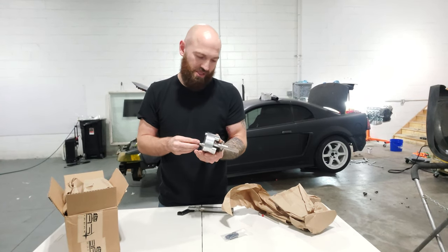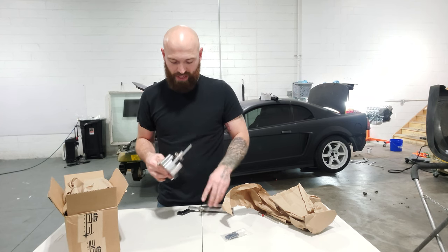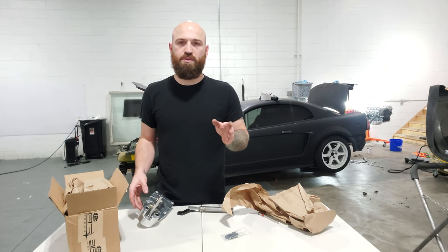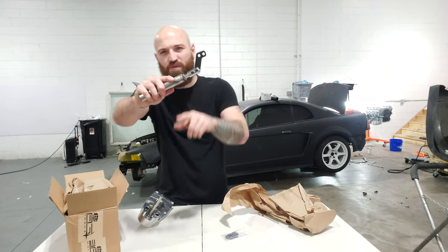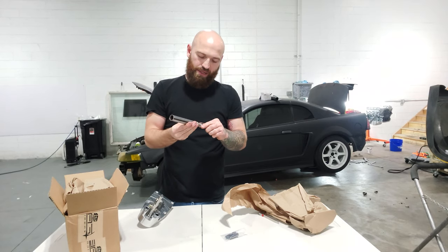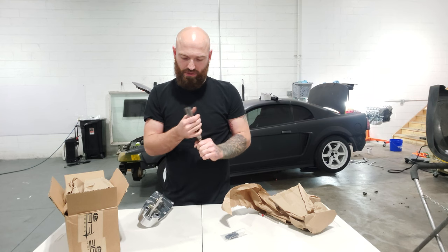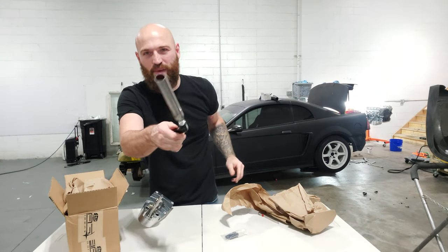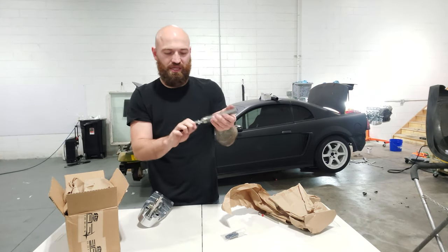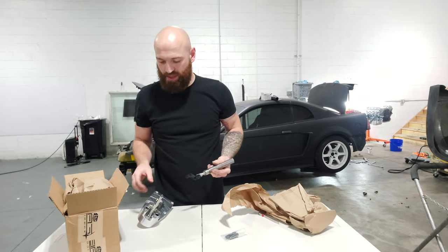Because my system is homemade, nothing about what I currently have on the car is going to adapt to this. So in preparation I ordered a short throw shifter for a T5, like a Fox Body Mustang — it comes with this kind of arm, a little elbow. It came with a really weird thread pitch, like 12 on 1.75, and I wasn't able to find a proper shifter. So in typical garage fashion I just made a homemade one — a piece of pipe rod tube with a union welded to it in the correct thread pitch, so it will attach to this.